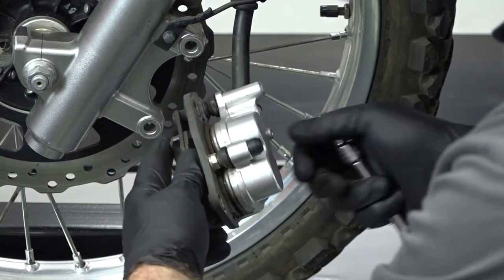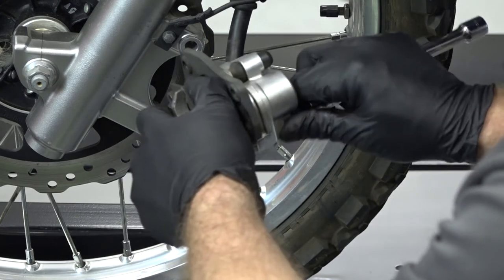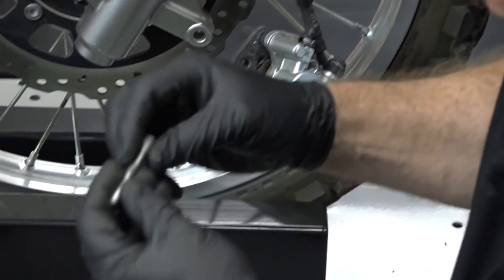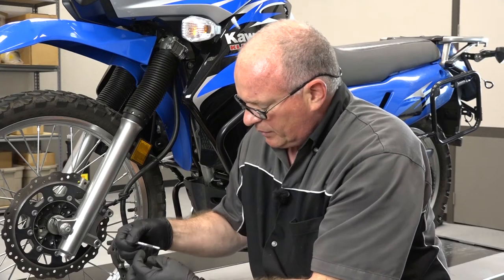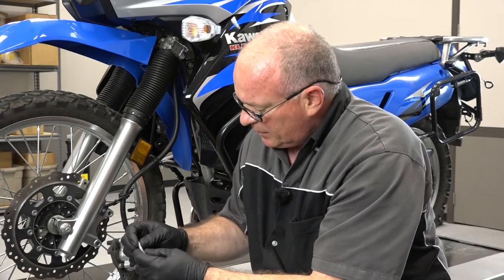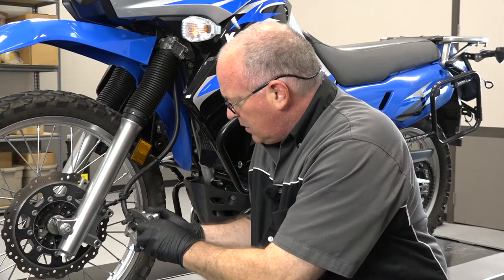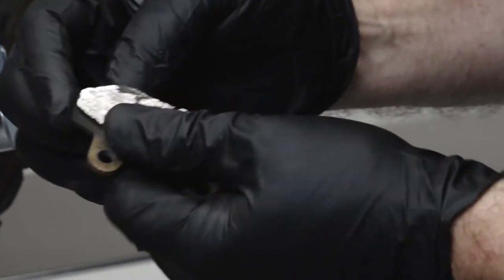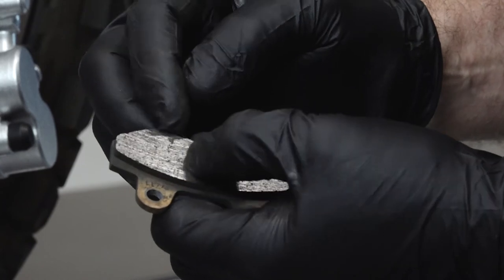And yes, almost nowhere. Let's go ahead and collapse the pistons back into the cylinder bores. Now we can go ahead and pull the pins all the way out. Something I didn't mention on the rear brake pads are these pins — these are in pretty good shape, but if there was some build-up on there, you need to wire brush that off so the brake pads can actually ride and not be impeded. Be aware of that when you're pulling yours apart.